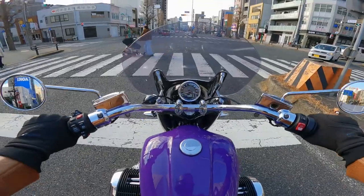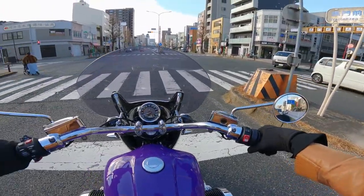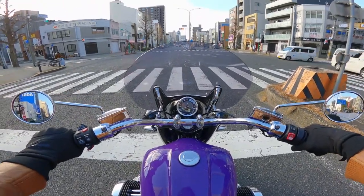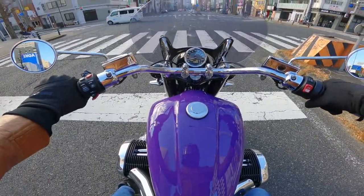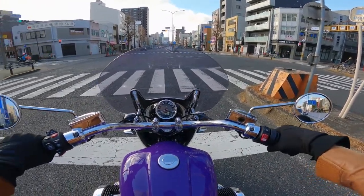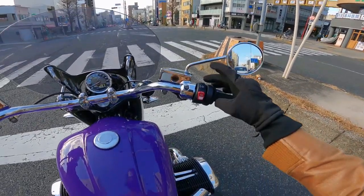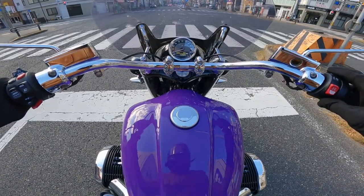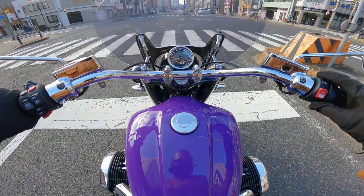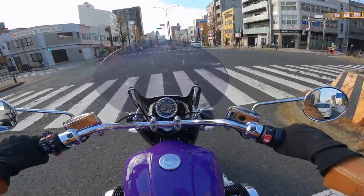This being the Classic, it's got a 16-inch front wheel, whereas the other ones come with 19-inch. So this one's got more of a bobber style to it, but because the tyres are quite fat, the overall rake and trail is the same as all the other R18 models, which is quite interesting. Now I've got heated grips on this one — you can see the heated grip sign on the screen, with settings three, two, one. I had it on one because three was just way too hot.